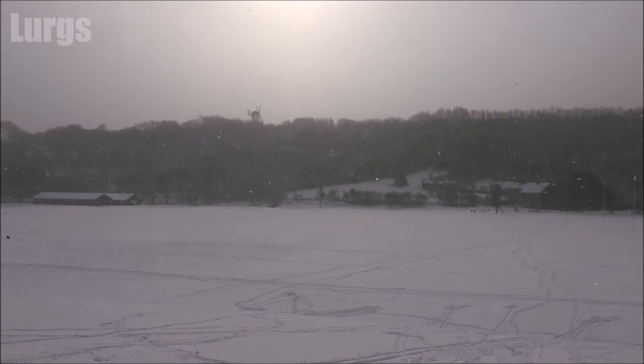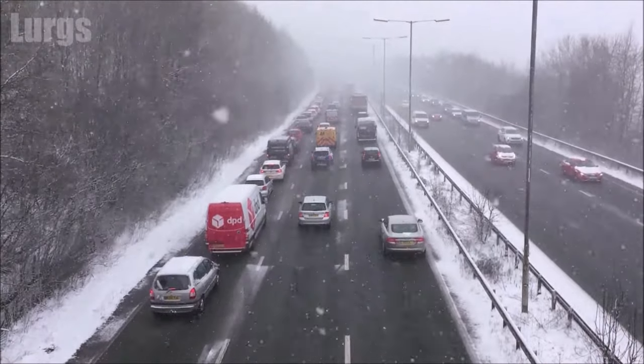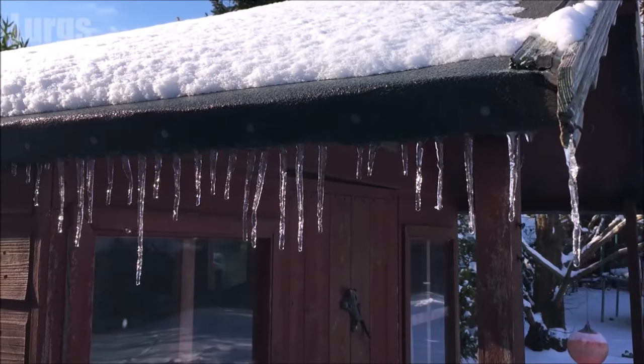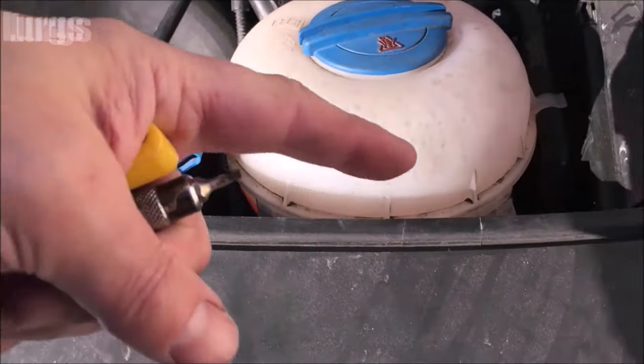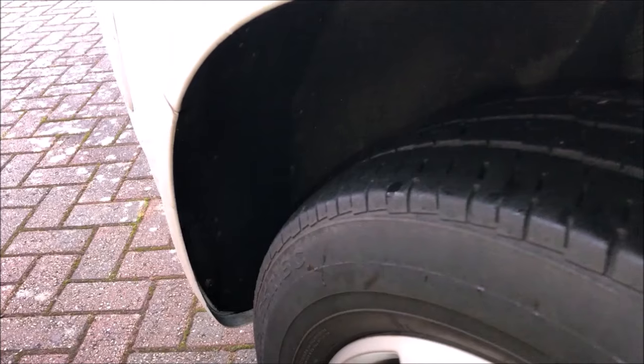The prime suspect for these not working is the middle of winter on a freezing cold day — it's not so good when driving your car or van because your windscreen washer jets can freeze up. First thing to do is find out if the pump motor is actually working. Open your bonnet, find the screen wash bottle — normally the pump will be on the same side, probably underneath the wheel arch. Get an assistant to squirt the stalk and you can hear whether the pump is working.